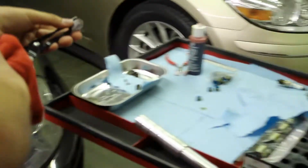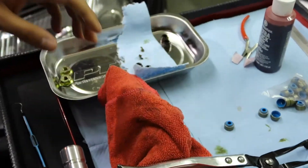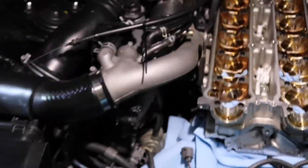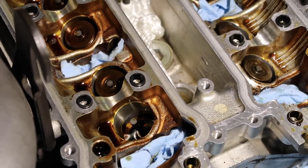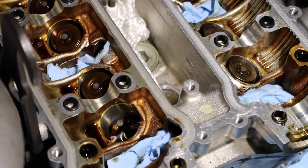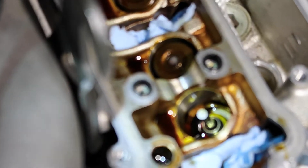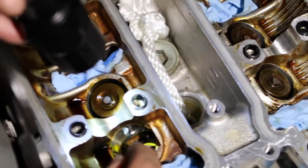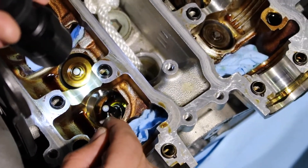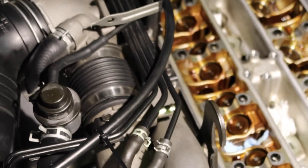At this point, come over here — you're not done yet with removal. We're going to use our Surefire flashlight to look inside there and make sure there's no residue, and there actually is on this one — part of the seal is still in there. So we're going to get our dental pick. Can you see that inside there? We're going to come in just like a dentist and try to pull this off. And there it is — you see that? That's what you want to remove.